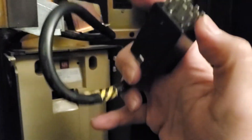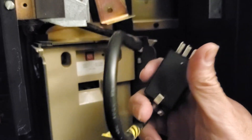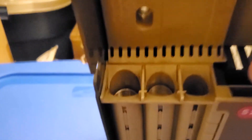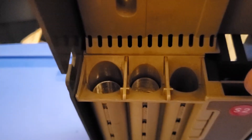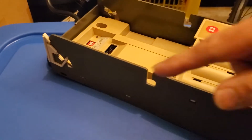Then you pull this cable out. This is a non-MDB type machine — it's an old model, the 369, the 12-pin type. What you have to do is take the coin mechanism out of the way, then simply take out all the coins.